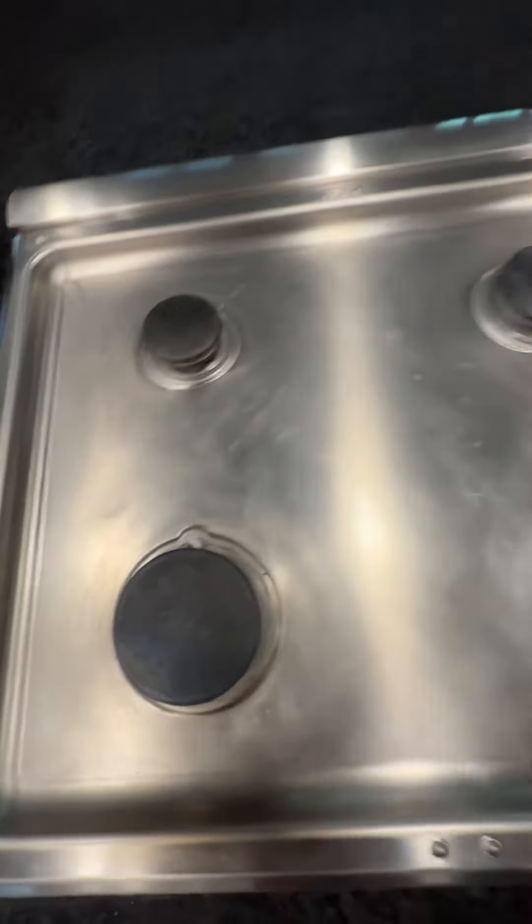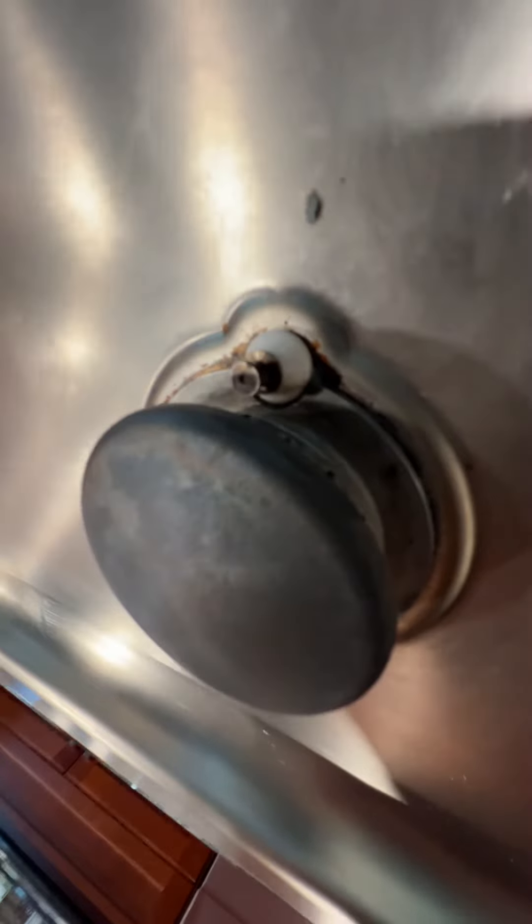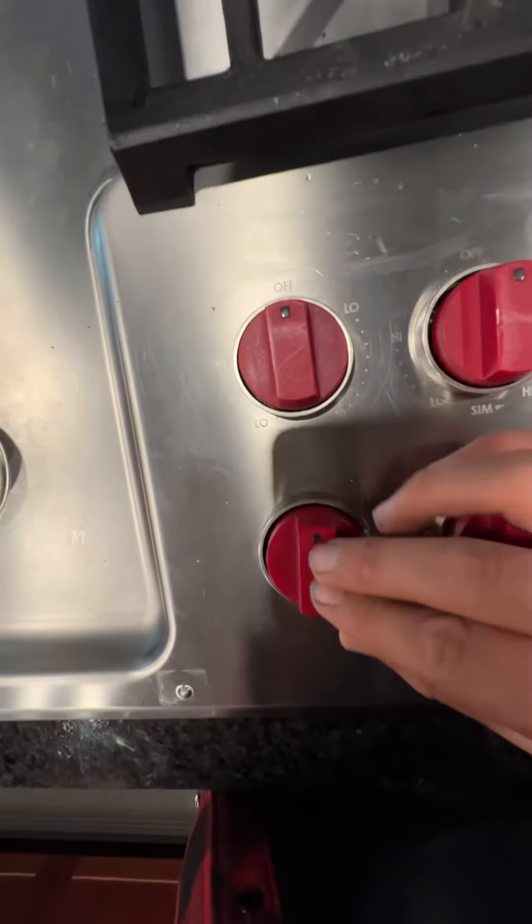To fix that, usually it's a cleanup, or if there's grounding from somewhere. You take your knobs off and then press them — for example, I'm pressing on this one. You see how nice it makes this noise and it's sparking straight and clean, straight to the burner. You can check all of these by pressing each one individually.